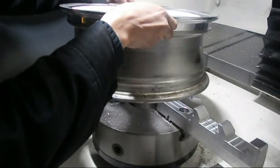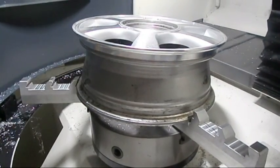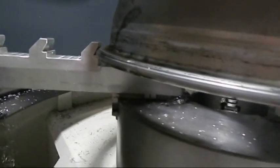When installing the rim to the chuck on the first side, make sure it gets into the teeth properly on the chuck. If one side is up a little bit more than the other, it is improperly inserted — please redo it.